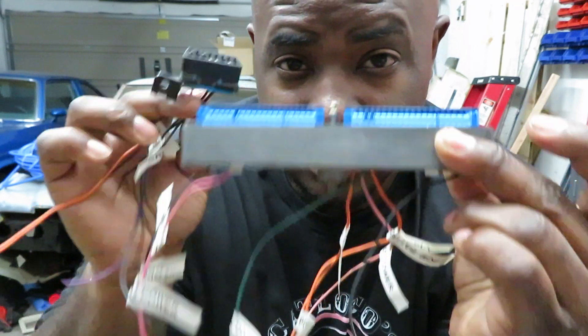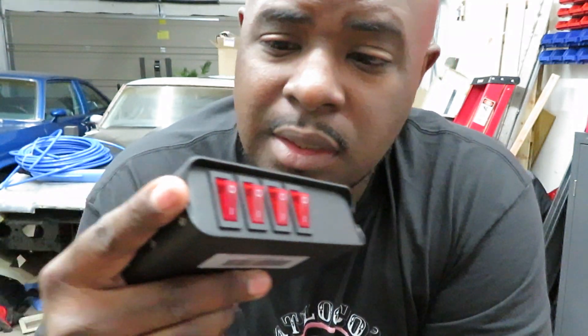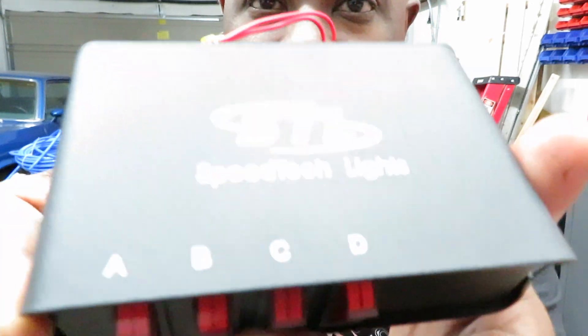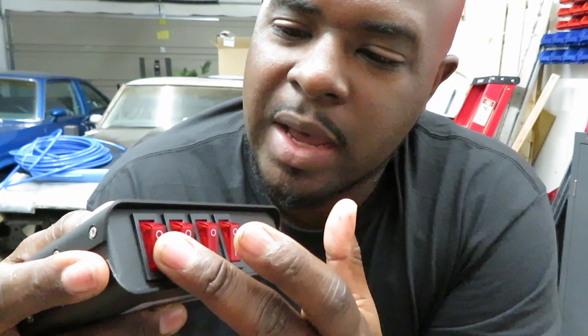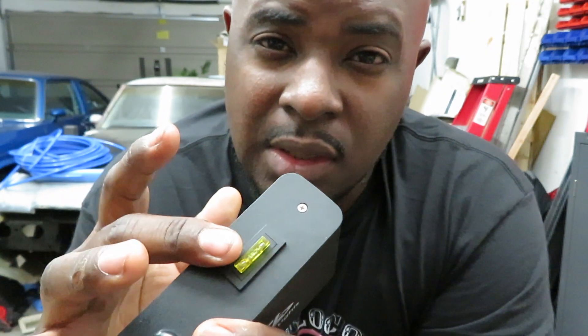You're going to need these two connectors to build this harness. You can get fancy and use a conduit box with some switches — some people use illuminated rocker switches or toggle switches for power and ignition, or you can just use one power switch. I actually went a different route: on Amazon from a company called STL I got this light switch box. I'm only going to use two of these — just A and B — one for my power and one for my ignition. The good thing is it actually has a 20 amp fuse, so you won't fry your PCM.